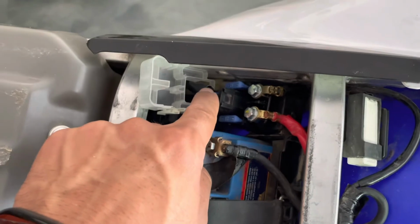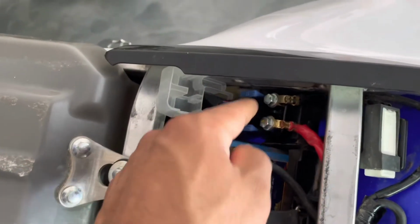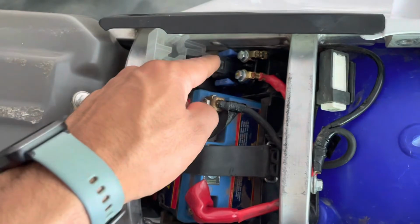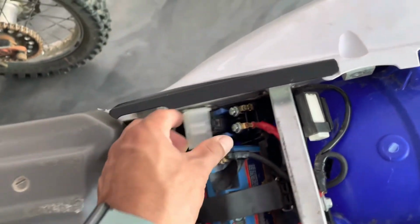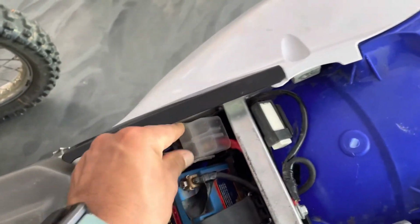Where you see those wires connecting to the prongs on the relay, that's where you hook up the positive and negative battery terminals. I just used some alligator clamps and powered that up, and then tested continuity here, and this relay was bad. Once I replaced that relay, it was like $40 for the OEM relay online.